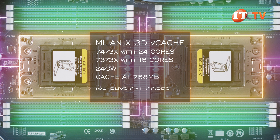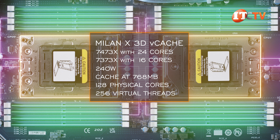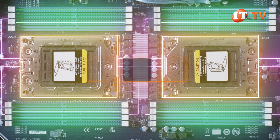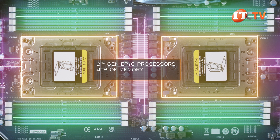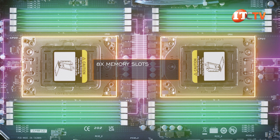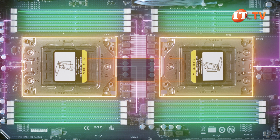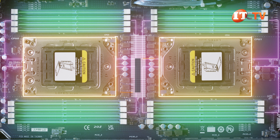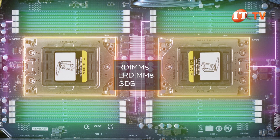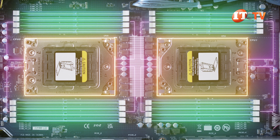With a full core count, it can support up to 128 physical cores with 256 virtual threads. Each CPU also supports eight memory channels, meaning each memory module is supported in its very own memory channel for maximum performance. Third generation EPYC processors are designed to support up to 4 terabytes of memory each, which would be 8 terabytes with 16 slots per CPU. But since we only have 8 memory slots per CPU, we get 4 terabytes maximum capacity using 256GB modules in all slots. Registered, load-reduced, and 3DS versions can be installed, but standard RDIMMs and LRDIMMs — not the 3DS variety — will only support 2 terabytes. 3D memory modules are made on a stacking die enabling greater density of DRAM chips on the module.